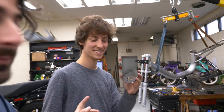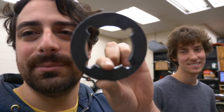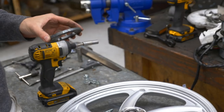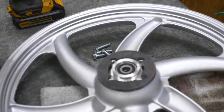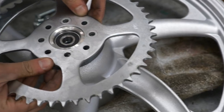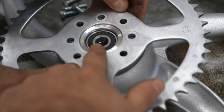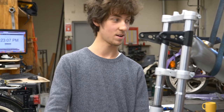We wanted to space the sprocket out on the rear wheel, so we made this cool spacer — designed by Bennett, property of Second Stroke Mopeds. It's a spacer with alignment built in for spacing out a rear sprocket on a Tomos. Pop it on — it spaces it out a quarter inch — then pop the sprocket on. It lines everything up and we still have enough edge so the sprocket centers to the wheel.